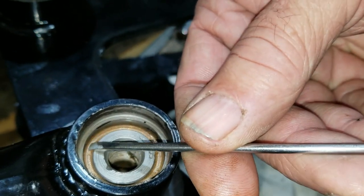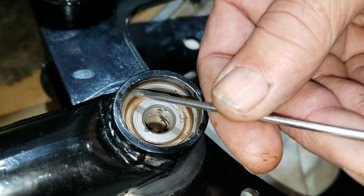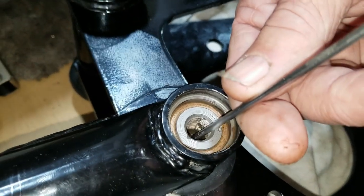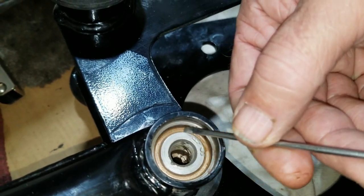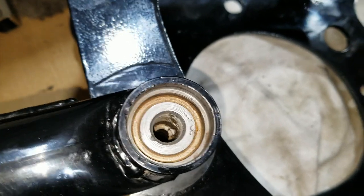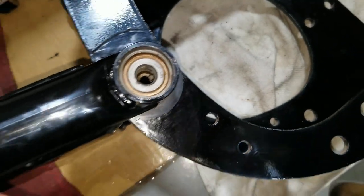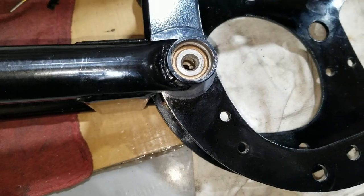There's a disc wick that goes in here and lays there, and then the welch plug goes up to this and pushes down on that. The other wick goes in here, and they feed each other, and that lubricates this bushing. So with the oil, like we said in previous parts, the oil that we put in here now is going to be there forever, because you can't add it after it's all together. It's supposed to use 140 gear oil, and I've got GL4 140.